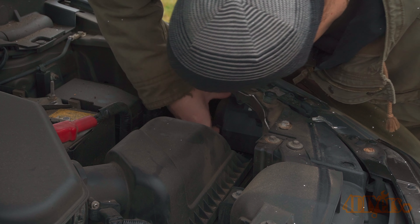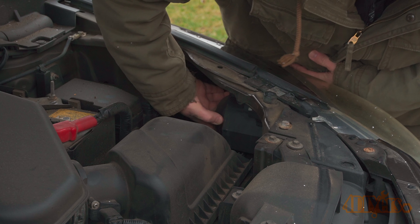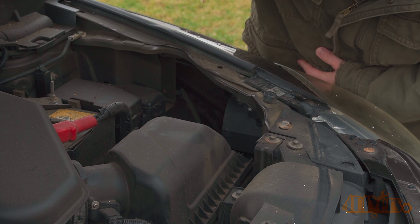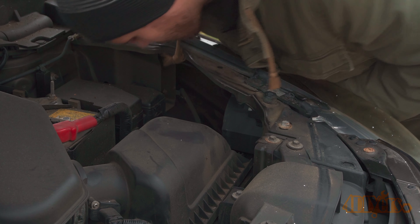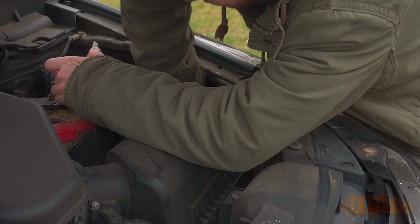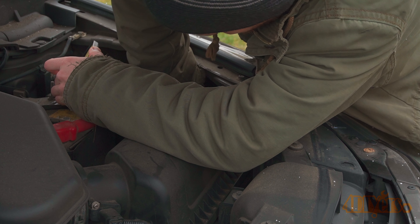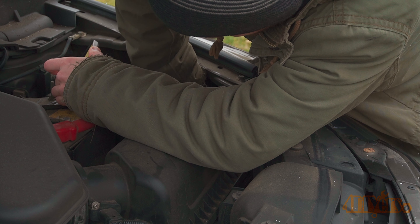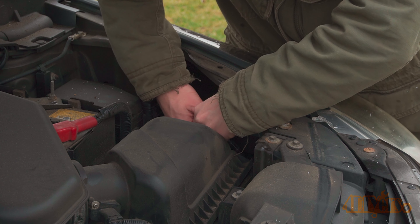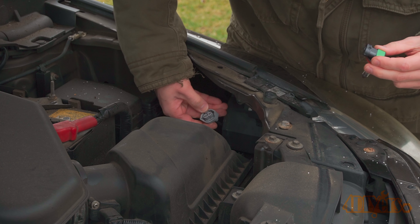Moving on to the driver's side. Again, the domed cap will need to be removed behind the headlight. There will be plastic tabs around the perimeter of the domed cap — grab onto these, twist counterclockwise, then remove. It was hard for me to get a camera in here without my hand being in the way. As you can see there is a bulb and wire connector. You can unclip the connector first or after when the bulb is out, whichever is easiest for you. I pulled the tang on the electrical connector and then pushed it off the light, then rotated the bulb counterclockwise and pulled out the bulb from the assembly.